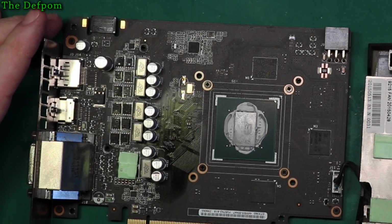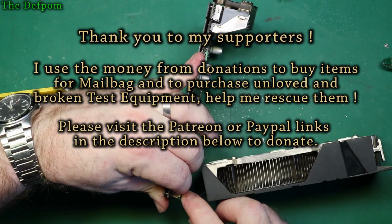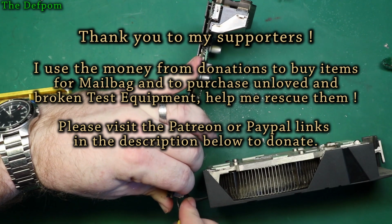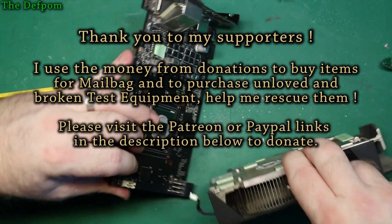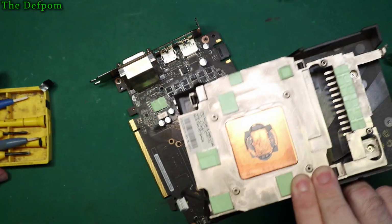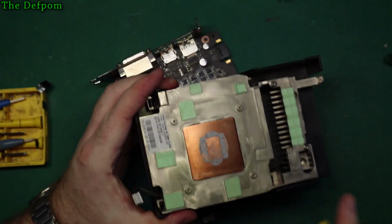Okay, let's just get this thing apart and have a look. These aren't really designed to be pulled apart again, you know, they are what they are. There we go. So I had to bend them out enough to get them to stay out of the way while I could stick the screwdriver underneath it. So this is the bit I need to clean, obviously. I have to watch out for these heatsink pads, right? These thermal pads, do not lose them.